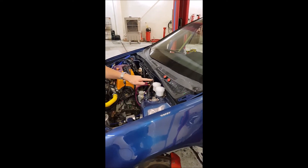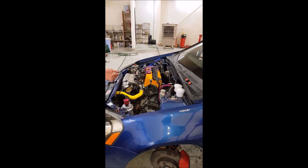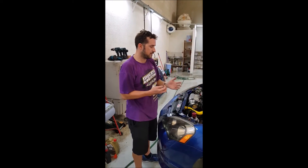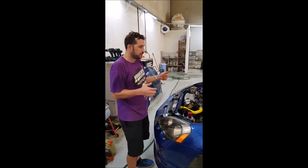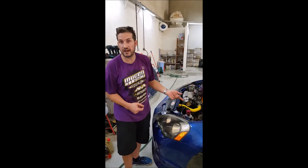The piston sizes in both of these are different. The front one is a more aggressive one — it's a slightly finer 0.625 — and the rear is a 0.7. So what that means is that we can just control the whole braking of the vehicle. The car is very much front brake biased, and also it means that if for any reason we have a tear in any of the brake line system, we can still stop the car.